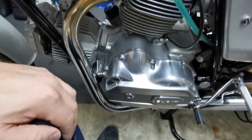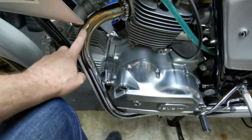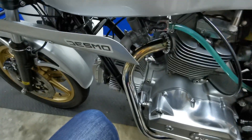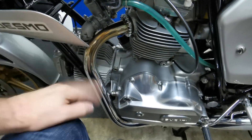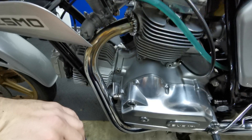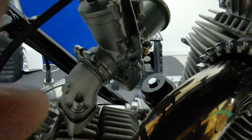The whole point of this exercise is to precisely measure the fuel-air ratio in the exhaust while riding at different throttle positions, and from that you can determine the carburation settings — the jets and anything else that needs to be set up. At this point I've rebuilt the carbs and they look absolutely stunning.